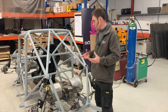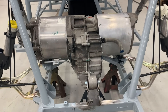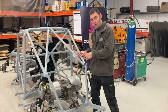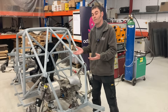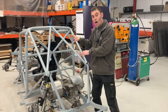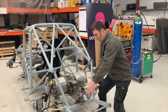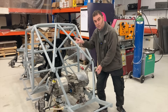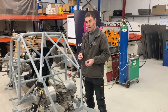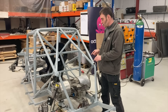What we went for is an EV Controls solution, because essentially it treats the front motor and the rear motor as if they were still in the car — it has all that torque balancing going on between the front and rear motors to balance the traction. The issue — which is actually a benefit — is that the EV Controls system fools these motors into thinking they're still in the car, which means you can't really run this motor backwards. If you flip it around, one motor wants to go one way and the other wants to go the other way, and in reverse they are speed-limited with no way to trick them if you're using an EV Controls-type system.